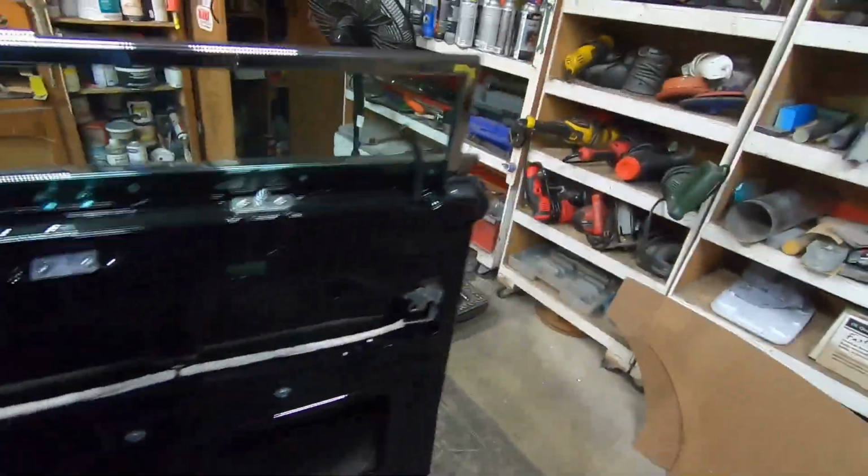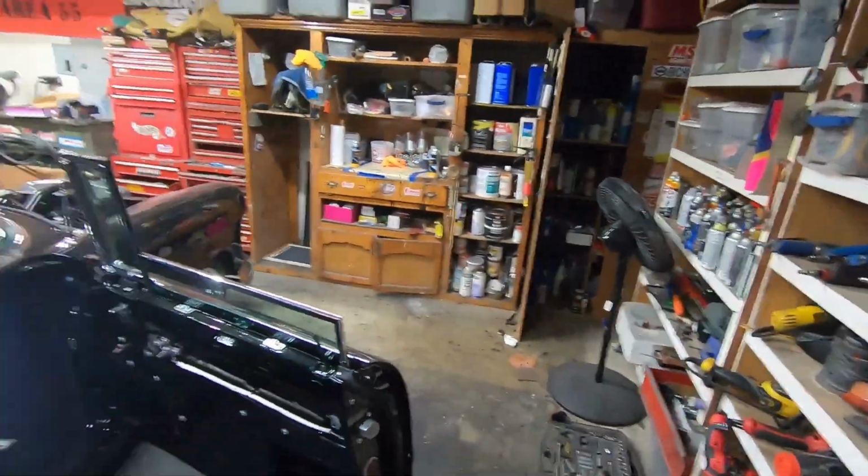So on the boards in particular, I'll tell you the best way to go is ABS plastic. If you have a plastics company close to you, you can drive to it and buy a 4x8 sheet of 1/8 inch thick ABS plastic. It's about $150-ish here in Tulsa anyway, because I called last year about a sheet of it. You can make your door panels out of that. It won't ever rot out and it won't ever warp. So that's the best way to go.